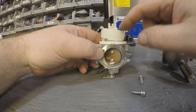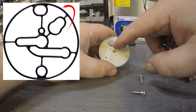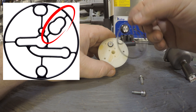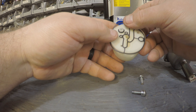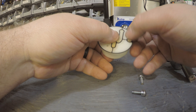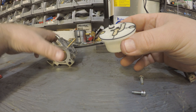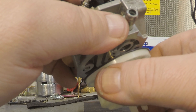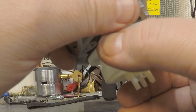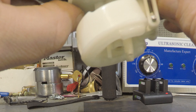There are two different styles of these carburetors — some have this o-ring built into the gasket. Before you order parts, make sure you've got the one that requires the separate o-ring. You can kind of press the gasket down in here; it won't be a snug fit but it should hold enough to get things together. It's better to put it on the bowl than to try to fit it on the carburetor. Once that's in place, keep this upright and put that center straight down through the middle without knocking the gasket out of place.